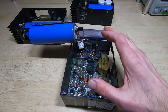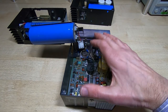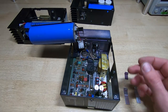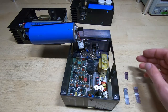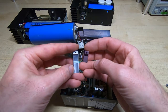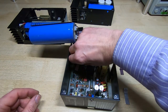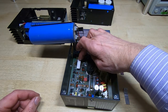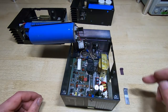I've cleaned up the supplies, tightened all the screws. I can't find anything wrong with them. I've done the usual static testing, but we knew these worked anyway because I have been running the machine. It's just nice to get them inspected and make sure they're not going to fail for silly reasons. They've cleaned up nicely. I've made up a couple of extended heat sinks — you can see the original on the right here. The new one is over twice the size but it does still fit in, although it looks like it overhangs other components. It doesn't touch anything; it's not close to anything. I'll just get these screwed in and that will vastly reduce the temperature of this particular device.